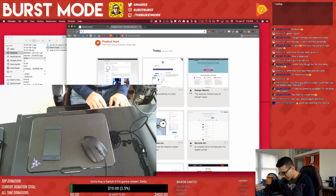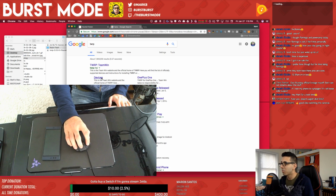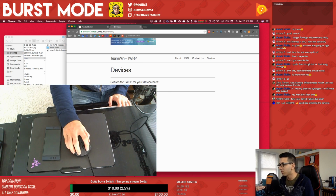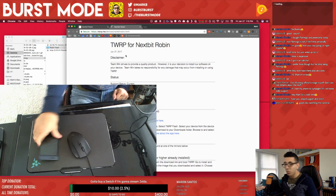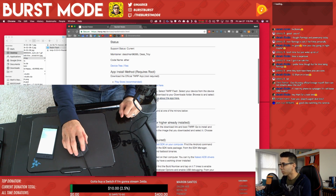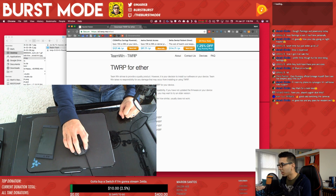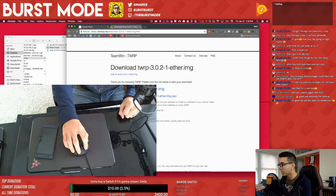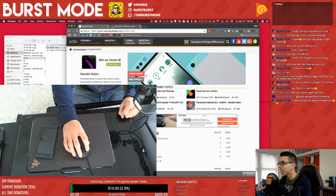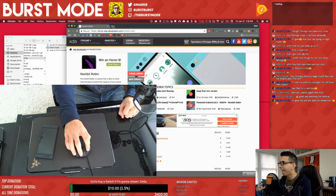So we are going to need a custom recovery. I've been using Team Win Recovery Project for a while. We're going to need the Robin version of this recovery. And while we're doing this, I'm going to go ahead and turn this device off. And we'll download Team Win. What's the most recent one we've got here? It's like last year in June was the last time we got a new Team Win image. That's fine. And I believe I've already downloaded the Google Apps, or haven't I? No, I've not. So we're also going to need the Google Apps.